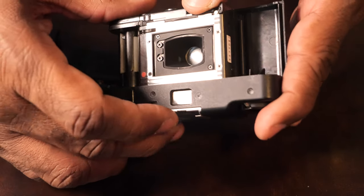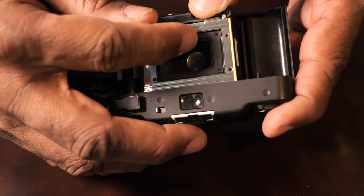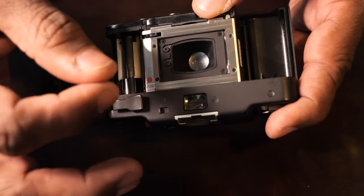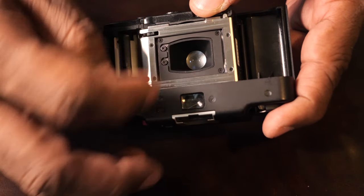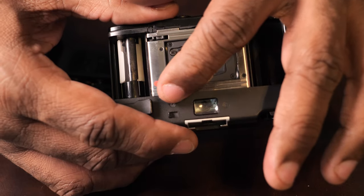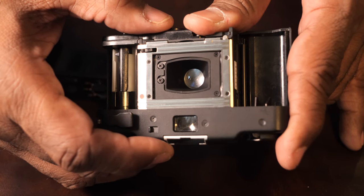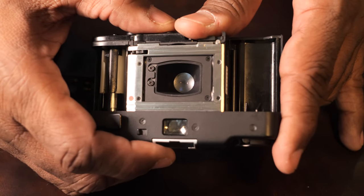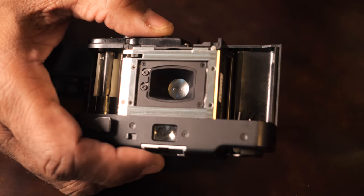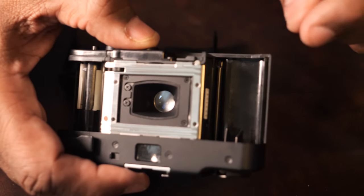You can't see the arm because it's under this dust cover here. This dust cover removes by hand, or maybe pry a little screwdriver in there. Remove the dust cover, and you'll see the silver actuating arm. You loosen these two screws and you can adjust the arm towards this direction. If you adjust it too far, then the shutter will sometimes just stay open and not close. But if you just adjust it a hair, because that's typically all it takes, it just falls out of adjustment slightly.